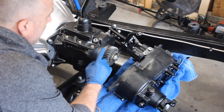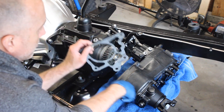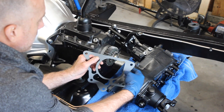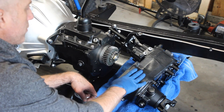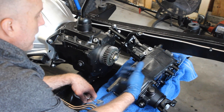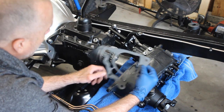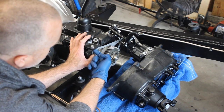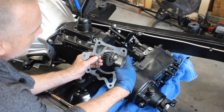I'm going to show you how I did it. The first thing you need to do before you install anything is to do a dry fit with your gasket. This was the gasket that came with my kit — I'll put a link in the description to that kit. That was the reseal or refill kit for the Dana 20 that came with the seals, some of the bearings, and a couple other components. The gasket itself, when I did a dry fit, I found that it was a little bit too tight up underneath the lip of the T-150, so I just trimmed off a little bit there.